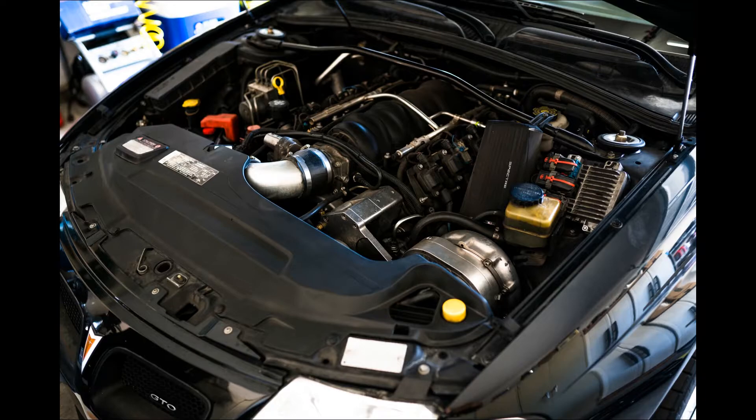I have these pictures I took going step-by-step about what we did. Just as an FYI, we replaced the original GTO alternator with a Caprice alternator. The reason we had to swap it was that the battery wasn't really charging — some days it would start first try, some days it wouldn't. Then the weekend we swapped it, the dash lights and gauges kept going dead and going on and off. So that led to that.